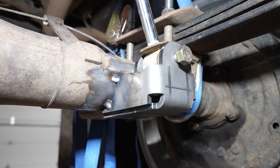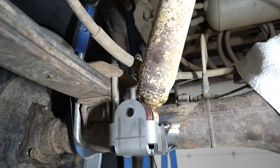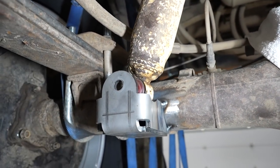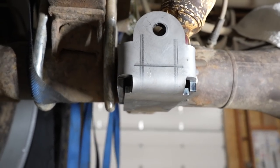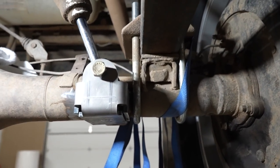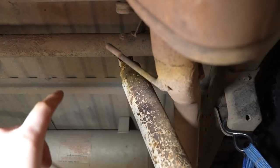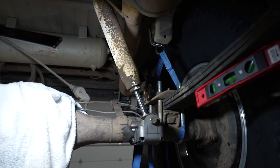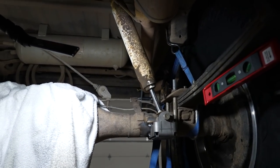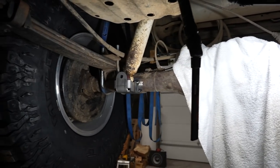Shock mounts are officially tacked on and in place — we got both sides here. I just put the bolt through the shock and leveled it close to what I needed. It's a little close to the spring there but there is enough room to weld in there. I wanted these out as far as I could get them so we have a little bit better travel. I don't think I'm going to add any on this upper crossbar — I'll just leave them where they're at. Now we're going to work on pulling the rear axle and finish up with this stuff.